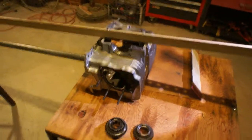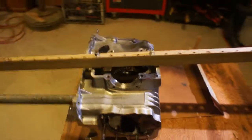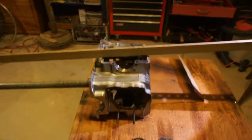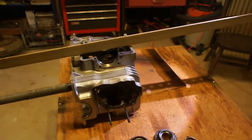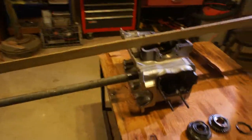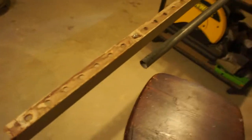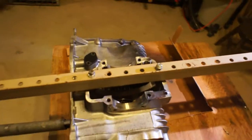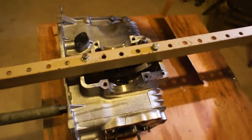Alright, let's show a little trick here. Right now we can't find our one and a half inch socket. This question comes up — you need a lot of leverage to get the big main nut off the pinion gear here on the Mini Cooper. So what we did is we just kind of raided our fabrication metal pile and we bolted this nice solid shelf rod to the front of the gearbox.